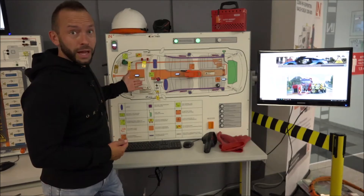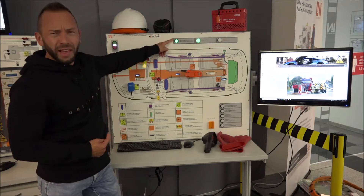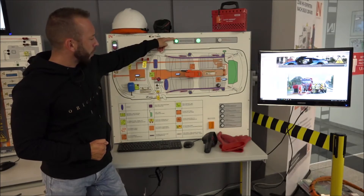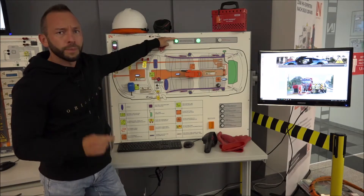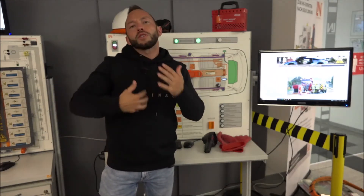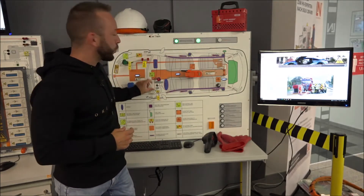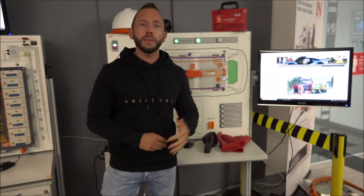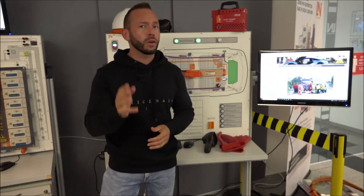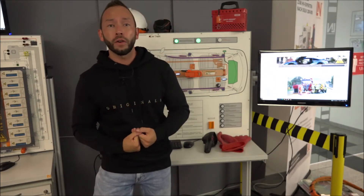The ready mode is on again and the smart key is in range — even though the key is far away from the car. Here's the trick: you must always test whether you can still activate the high voltage system, because some car owners keep a spare key inside the glove box or somewhere around or inside the car, meaning you can still activate the high voltage system.